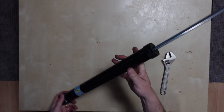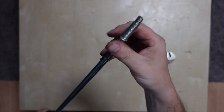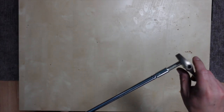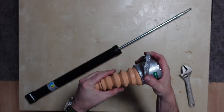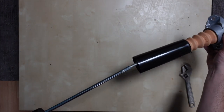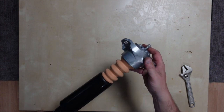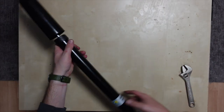We're so close to getting ready to install this lift, but first let's assemble a few of the different assemblies for the front and rear suspension. We're assembling the shocks and struts to get ready to put them on the car. For video purposes we're going to do some of this kit assembly inside for better lighting. First we're going to install the shock extender on the rear — make sure when you install this to use the provided thread locker to hold that in place. Next grab the shock mount and the bump stop and fit those together — it's a pressure fit — then put the shock cover on and slide that over the entire assembly. Finally fix that with the nut that holds it all in place and we'll get to tightening and torquing that down later.